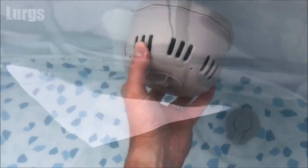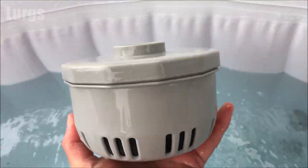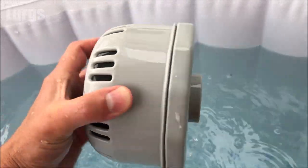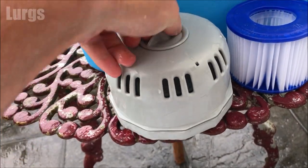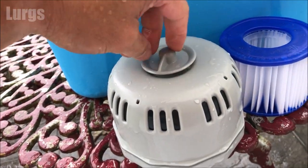Now to remove the filter mechanism, gently unscrew it anti-clockwise. Just keep going — there we go, so that is now removed. The filter is inside this housing. Let's put this on a table. Flip it upside down — you've got this locking nut screw mechanism here, so unscrew that anti-clockwise and remove that.